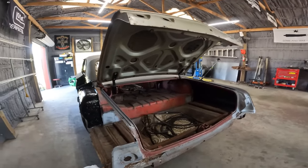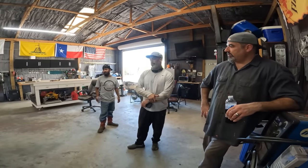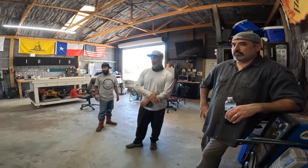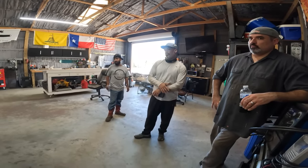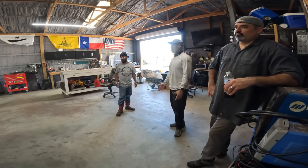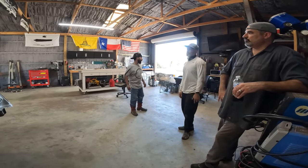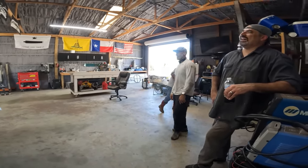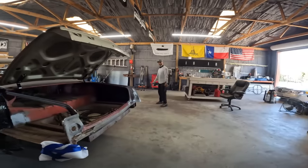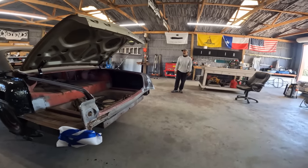After the quarter, it's basically little patches here and there. A couple weekends of little patches. I think what Bubba suggested is good. We fit the front end, get everything lined up real good, get all the gaps where they need to be, and then we can get these doors down to bare metal and epoxy. I'll buy black epoxy. We can do the same to the fenders, that way the car can look uniform, one color. Then we'll start messing with the roof rails.